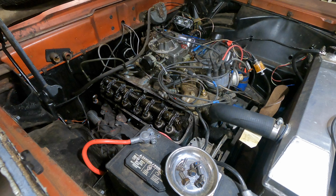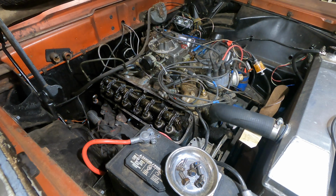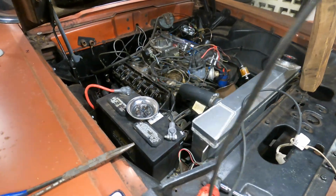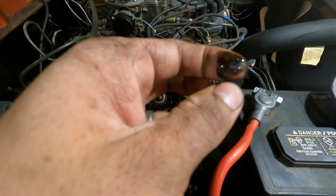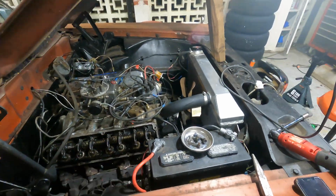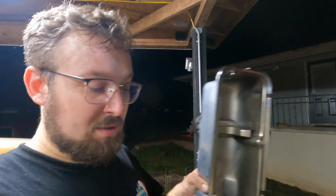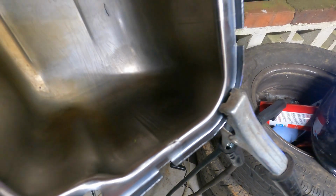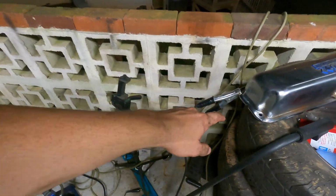Ripped valve cover gasket. All right, well, we're gonna peel this gobbly mess off, get her cleaned up, and install this new cork one. I don't think it looks too bad in there. There's a little bit of gunk, but you know, I don't think you'll be mad at that. For what we paid for this and how well it's run, we got the valve cover cleaned up itself. Looking pretty good. Problem though, right here is a slight hole. So we're gonna use our Harbor Freight welder, and we're just gonna gob a little bit of metal on there, and it'll probably be good.